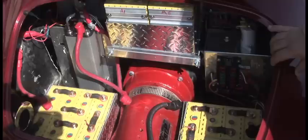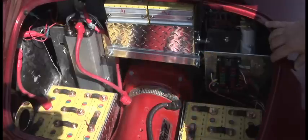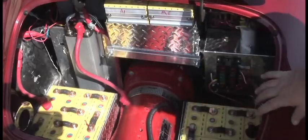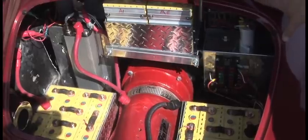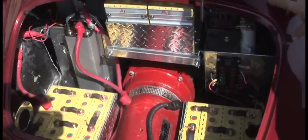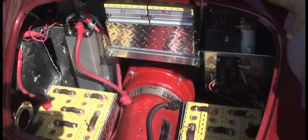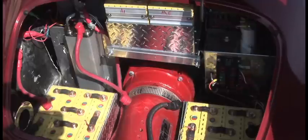The Kelly controller is what applies that pack voltage to the motor. Motor speed is a function of voltage, and torque is a function of current. If we applied the full battery pack directly it would immediately go full speed. We use the accelerator input to modulate a 16 kilohertz pulse-width modulation waveform to provide an average voltage and current to the motor. This is a fairly efficient conversion — about 95 percent — and gives us complete control of the motor from a very low speed crawl up to very smooth acceleration up to 85 miles per hour.